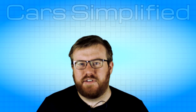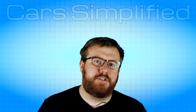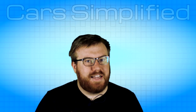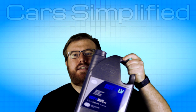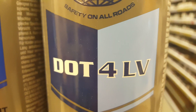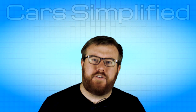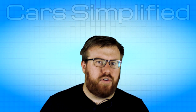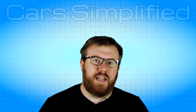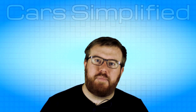There are also some viscosity differences that vary from brand to brand, but they're all going to be an improvement in DOT 4. If the viscosity is vastly different you'll see something like this — this one is DOT 4 LV, which stands for low viscosity. Some cars will actually require that low viscosity brake fluid right out of the factory, but if you live in an extremely cold environment it's also an upgrade that lets it flow better through the brake lines when viscosity would be thickened by the cold.